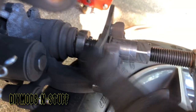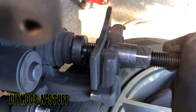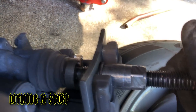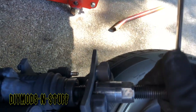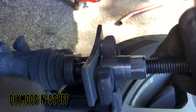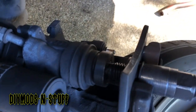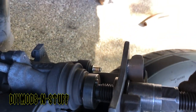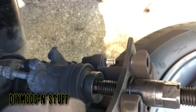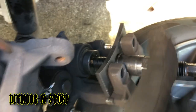You can push these in using a normal rear caliper tool, the same way you would push any piston — just go gently, make sure everything's going in nice and smoothly. Make sure you don't kink the seal when you're pushing the piston in, otherwise you're going to have a bad day.